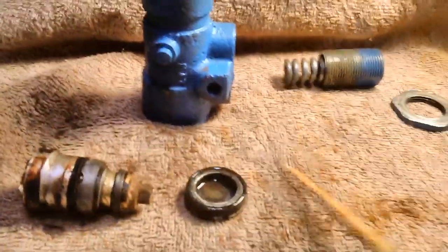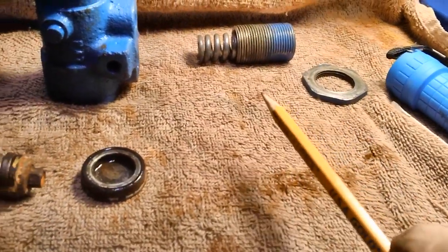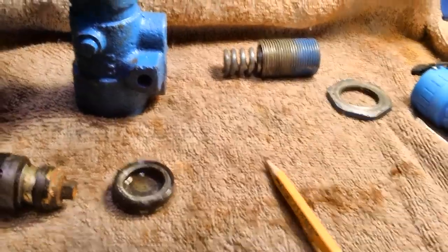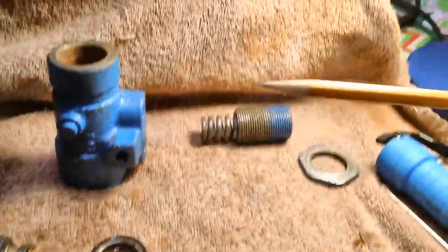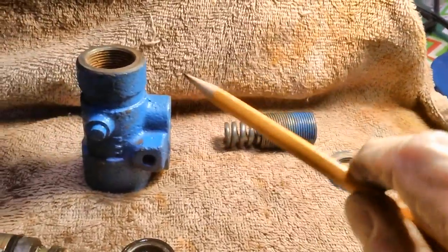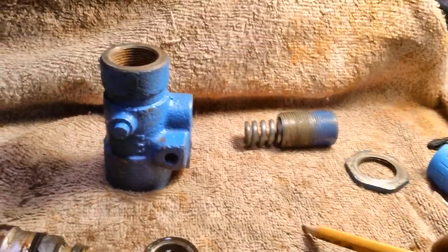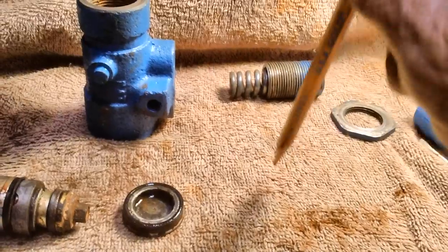When you have front disc brakes on the front of a car and drum brakes on the rear, you want the disc brakes to grab first. Now, this is a car that weighs over 2 tons, so you want the car to brake first like this. And so what happens is the brake fluid comes directly from the master cylinder straight into the calipers on the front disc brakes.